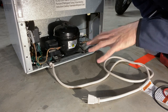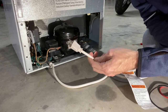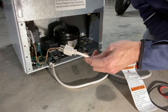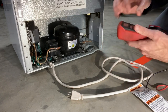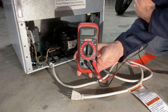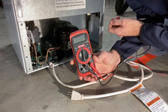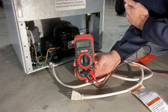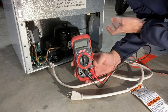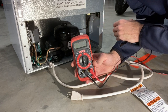I don't know the issue with this one, but since I don't know the history of this unit — since it was just sitting on the side of the road — I want to do a few preliminary checks. The first is to make sure that we don't have any shorts to ground, to make sure that if we plug this into the wall it's not going to immediately trip a breaker because electricity is going straight to ground. To do this you're going to need a multimeter — this is just a $25 Craftsman multimeter I've had for probably 15 years, but even cheap $3–$5 multimeters from Harbor Freight should have these functionalities.